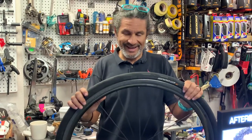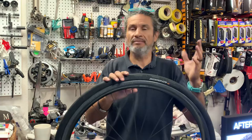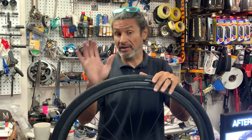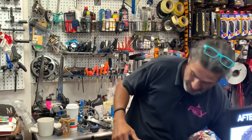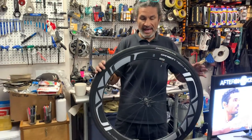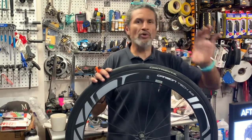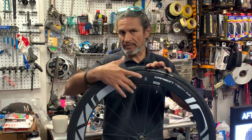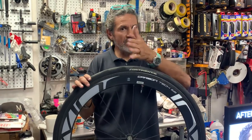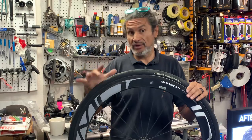Aesthetically, sure, it looks more pro and your bike looks a little sexier and racier with something like this on. But you have to choose what's the right reason you are buying a carbon wheel. As you keep going up every category — low profile, mid, and deeper section — you can venture to say about 100 grams total weight increase between each one of those different levels of rim depth. But you're buying the wheel now for pure aerodynamic benefit.